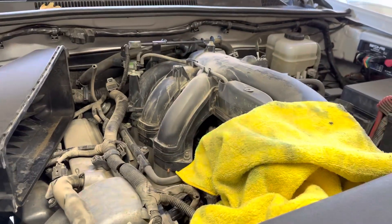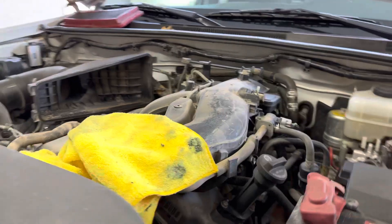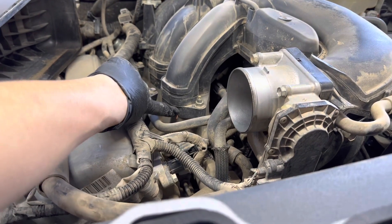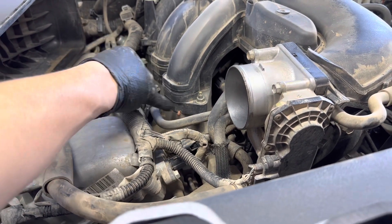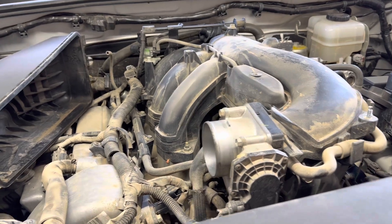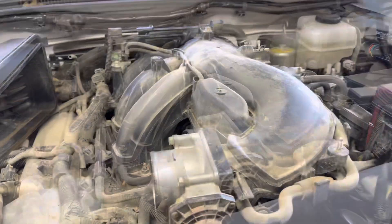Just make sure nothing pops up or gets in the way as far as fine dust and debris when you take the manifold off. This spacer is going underneath that part and the aluminum intake manifold — so the plenum sits on the spacer, raising it up a half inch. It comes with longer bolts because the stock ones are going to be too short.